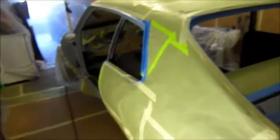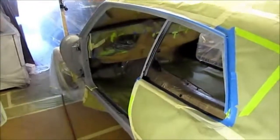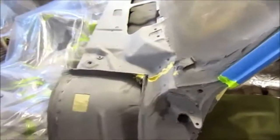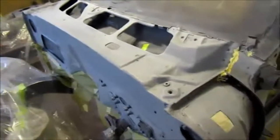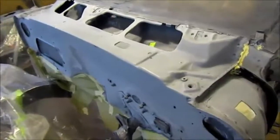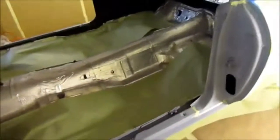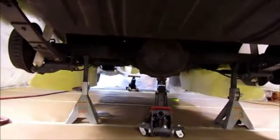And pretty much set to put on sealer. I'm going to be putting on red oxide sealer, and then after that flashes a little bit, I'm going to apply my base coat 2 to 3. Basically I'm going to get coverage and then +1 and do two coats of clear, and that includes the rock on the bottom. In the car, I raised it up so I can get to the rockers, and you can see I raised it up quite a bit.